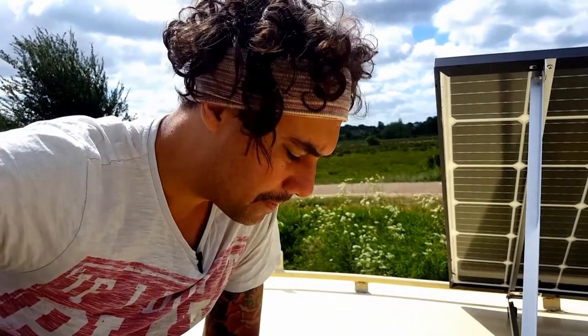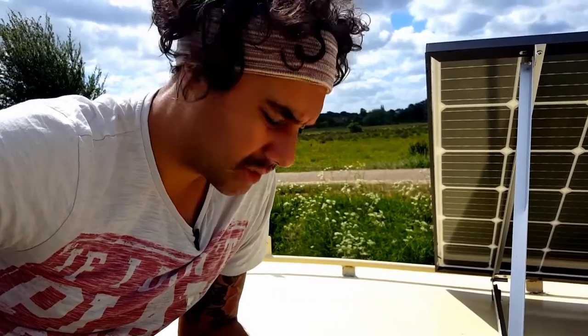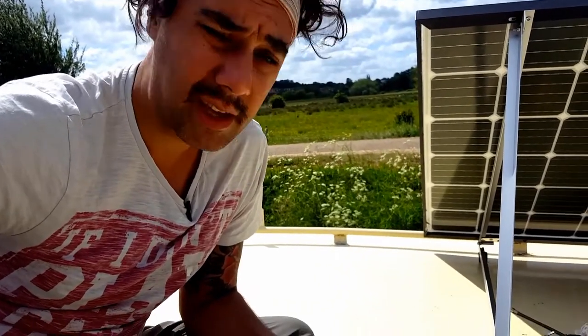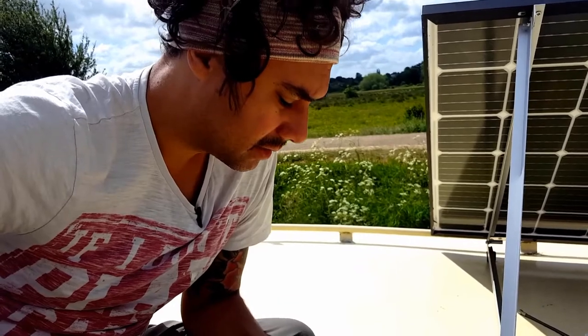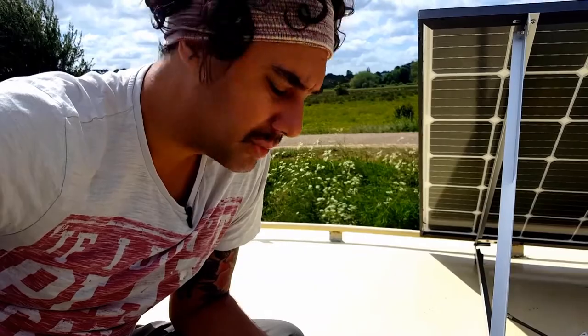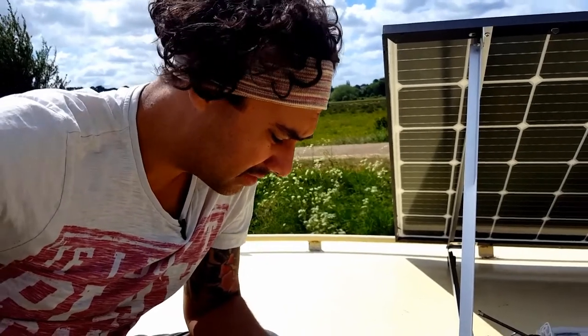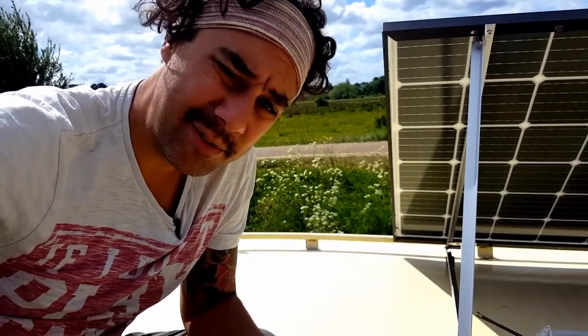This is why I took the ceiling down in the bedroom a few weeks ago - to see what was underneath. I was suspecting this might need replacing and I just wanted to know where the cables were coming from, how much room there was, how much water there was, to get ideas about what we might do. There are also some other cables I'd like to bring up the front that we don't have room for, and we can't put any more through the roof. So what I'm thinking is putting in a gooseneck, an inverted U-bend, that will allow more cables through and keep it all dry, and hopefully be easier to take off and deal with the rust.